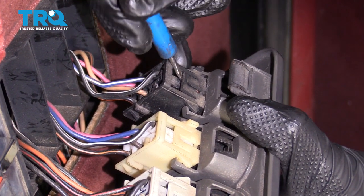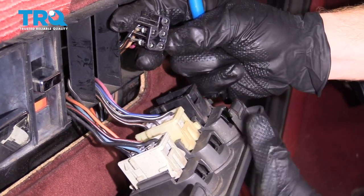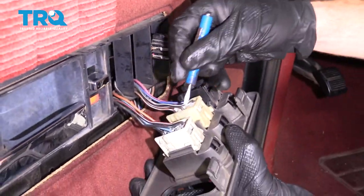I'm just going to use a pocket screwdriver. I'll come right in between this area here. We've got that off of there. Just inspect it — make sure you don't see any funny colors. If you do, it's corrosion and it needs to be dealt with. Let's set this aside and do the same to the others.